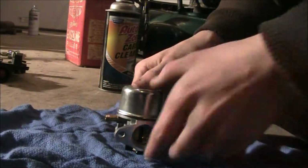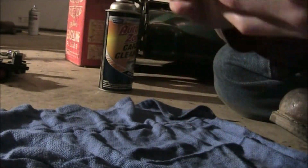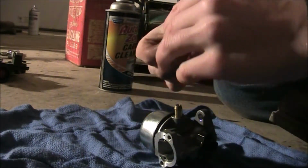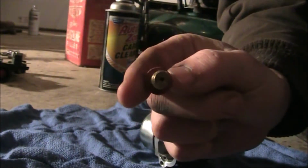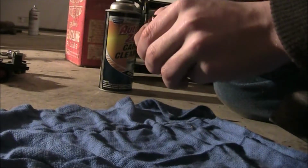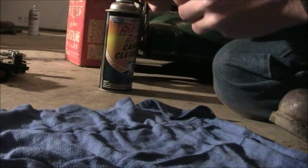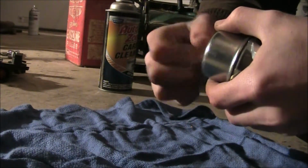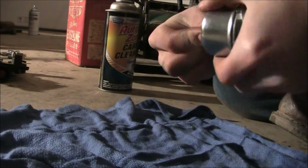Make sure it's sealed up all the way around, and we don't really have too much of a problem on this one. The gaskets can be orange or black or whatever. Just put that on there, and make sure you don't clog up the jets when you do this. Screw it in there. If you want to know what size these bolts are, they're usually 13 millimeter. In my experience, I've used that in the sockets and they work perfect.